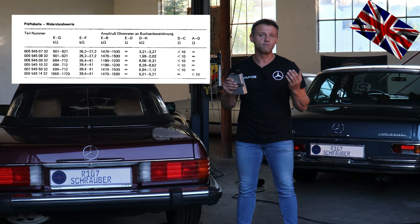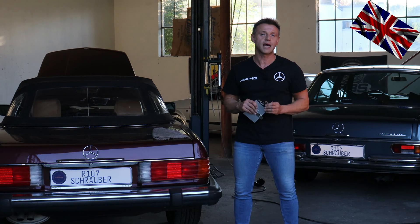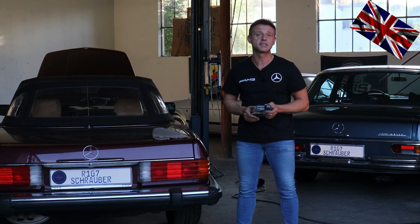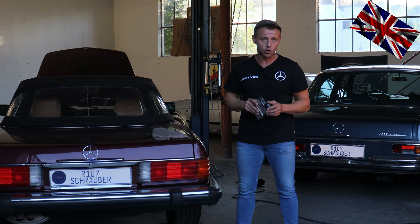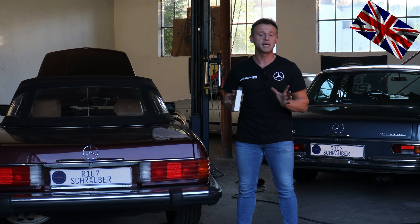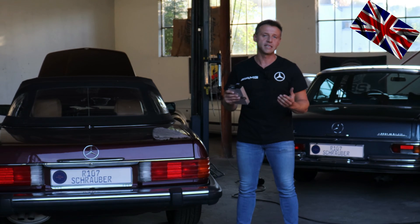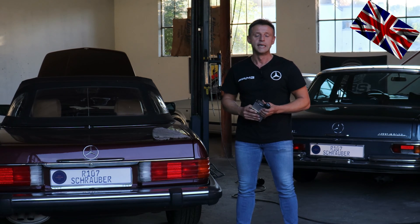We have checked all pins of the plug which sits in a socket of the control unit of the cruise control. We were checking if the resistance was correct. I have pulled the chart from the manual for reference. Since the plug was introduced and altered from 1987 onwards, in this very case a 560SL from 1988, this version has been mounted. You find all information in your manual if you want to check resistance, or you can send the control unit to me and I will check it for you if your cruise control is malfunctioning.